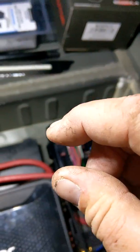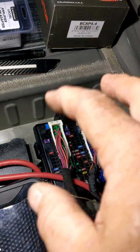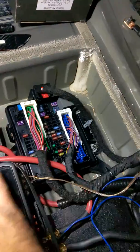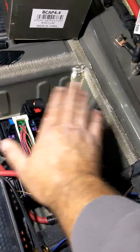As far as the plate, what I did was — you got three mounting points over here, here, and under the wire. That plastic is about three-eighths thick, so what I did was I took a side cutter and cut it down to a quarter inch, which obviously lowered it. When I put that plate down without the amp in there, I took a ruler and it clears all day long.